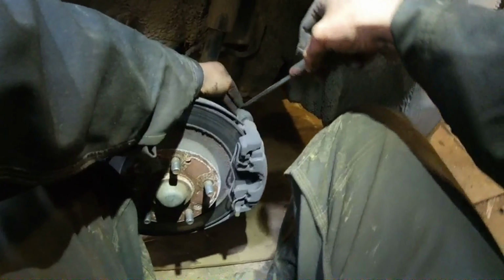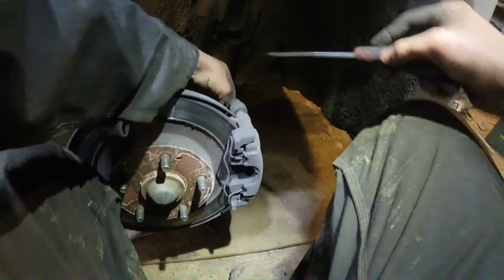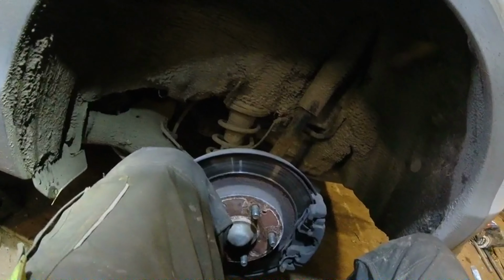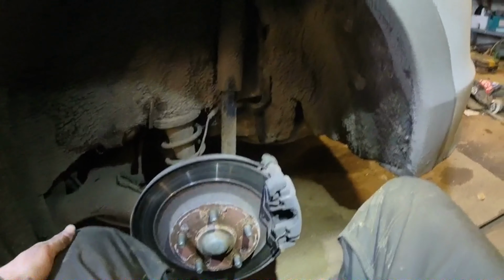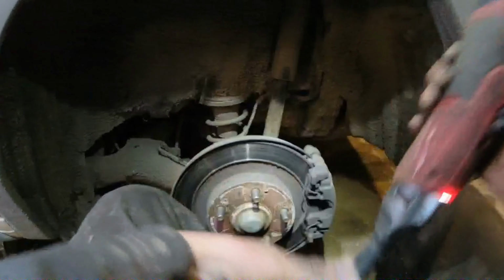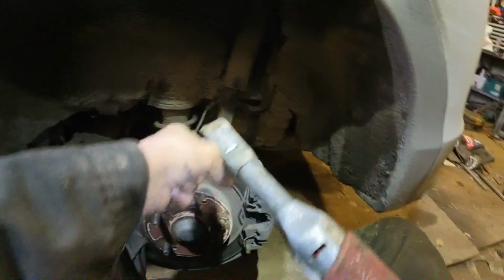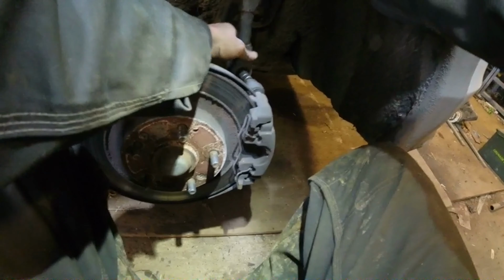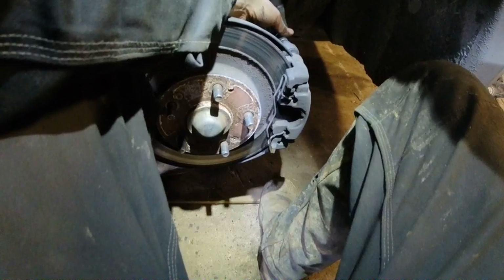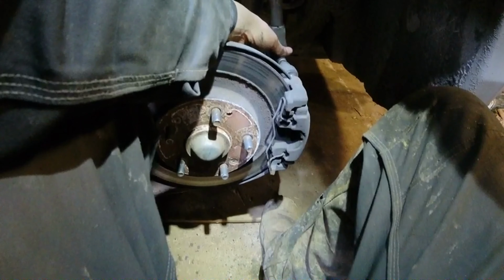Same thing back here. Pop off the cover there for the slide pins, top and bottom. Don't forget to put them back on, I did earlier. 7mm Allen key again. Can't get in with an impact this time. Make sure you're well seated in this, because I stripped one of these one time years ago. And they were a lot tighter, but still stripped it.